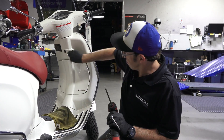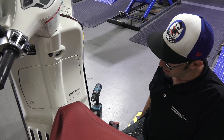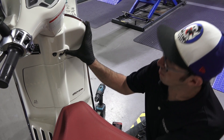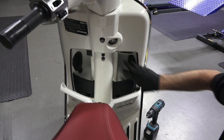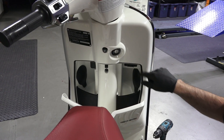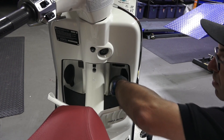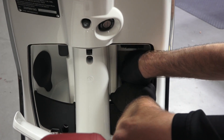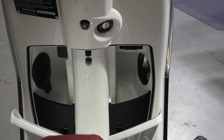Let's jump into pulling this glove box off — maybe ripping it off after you see how it's done. You want to pop the glove box open. This is a Primavera; on a Sprint there's going to be more going on on the right side with a slightly different cover, and you'll need a T25 Torx to take that cover off first. Start by removing these two black caps — on the Primavera and Sprint there's only one, and they have a pull tab and just pull right off.